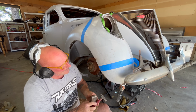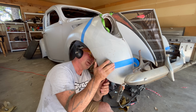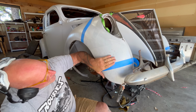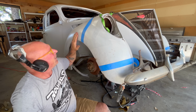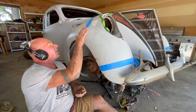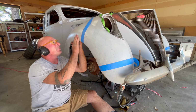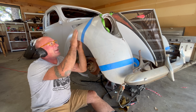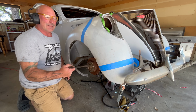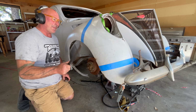Yeah, so it's low here. I'm gonna flip back to this. Yeah, so that's closer. This is still a pretty good crease right here. So I mentioned that slapper, that flat bar, it really is just a pry bar. But instead of trying to put hammer marks here, I'm gonna use that bar, and all this does is stretch out the surface here, contacting the metal instead of a hammer mark.